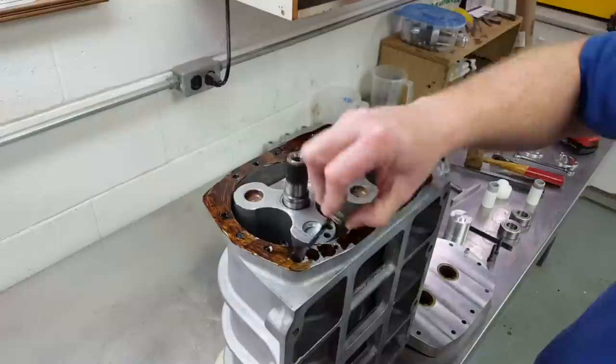The procedure for installing the seals and bearings is repeated for the rear bearing plate. The PVC seal protectors are pushed over the ends of the rotor shafts, and then the rear plate is dropped in place over the seal protectors. Once the bearing plate was in place, I hand-threaded the screws into the back of the plate, then torqued all the screws in a center-out circular pattern to 250 inch-pounds. If you've ever torqued down an intake manifold or a cylinder head, you use a similar pattern — start at the middle, then spiral outward, usually in three steps so that you don't warp the plate. After that, the aluminum bearing driver is used to drive the bearings in place until they touch the ends of the pilots on the rotor shaft. The recess in the rear bearing plate is deeper than the width of the bearing, so the first thing that hits is the bearing shoulder on the end of the stub shaft on the rotor.